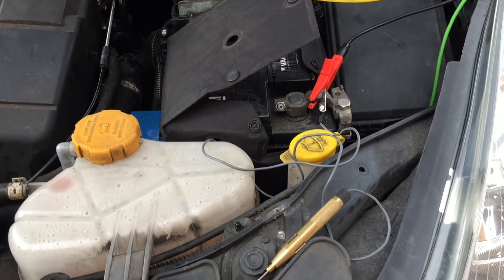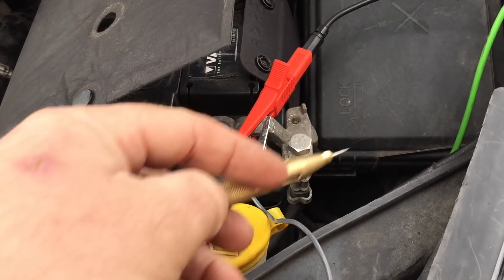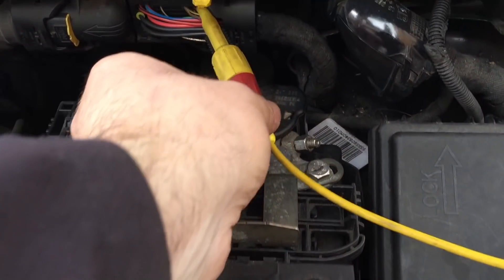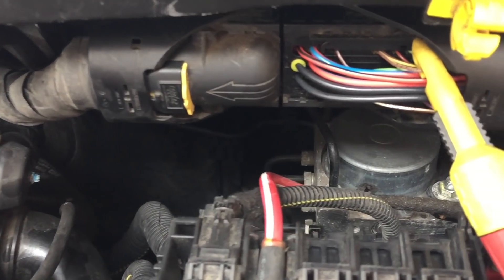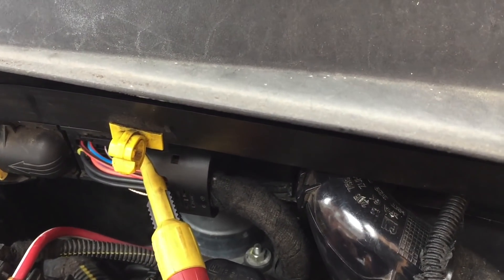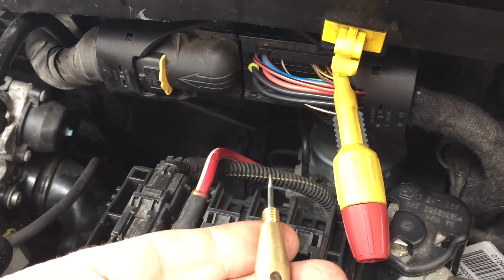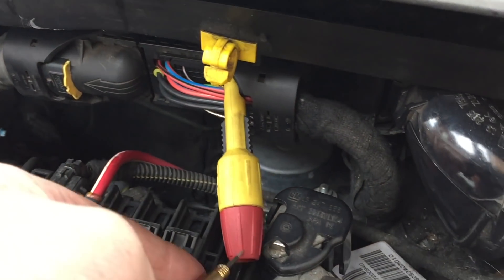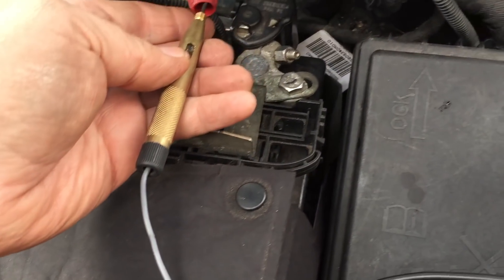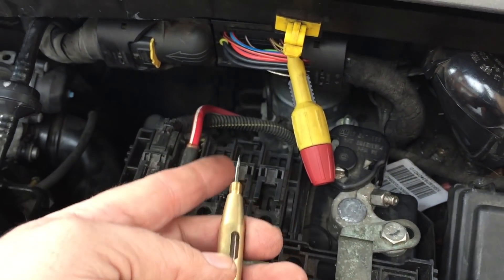I wish I'd kept the camera rolling because I can't repeat this experiment. What I done here was I had my small diagnostic test light - that's on the ground side of the battery and then I go to the positive side, test light lights. So when I was just mucking about with this thing here, what I done was I took the lead out and put it onto pin 80, the brown with the white trace. When the car was running, I grounded that pin. That shouldn't have any effect because the ECU is just providing ground anyway - this test light is just providing additional ground. But when I done that the car stumbled and it died, and the test light lit.